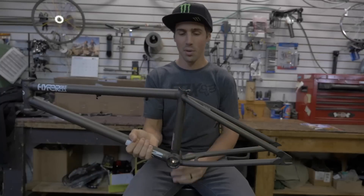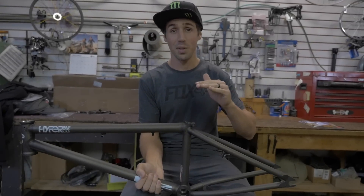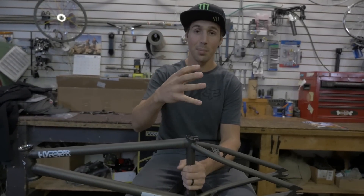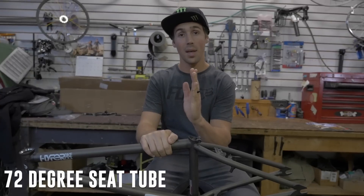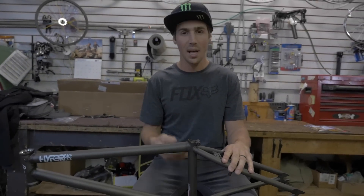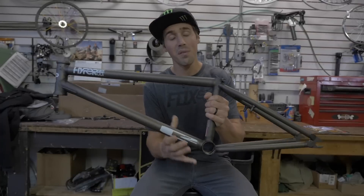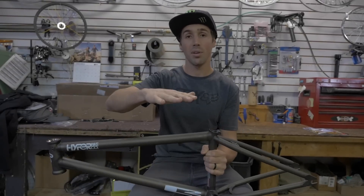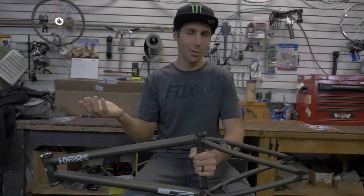The standover is 8.75 inches, which gives it an old-fashioned BMX look, but I also run a little higher seat because I like doing double and triple bar spins — I like to be able to pinch the seat with my knees. The seat tube angle is 72 degrees, which is more straight up than some other bikes — only by half a degree — but it'll keep the seat closer to your knees for bar spins. The bottom bracket height is 11.4 inches, which is 0.4 lower than the last version at 11.8. That lowers your center of gravity so you stand more straight up and a little closer to the ground, keeping you more level on certain tricks.